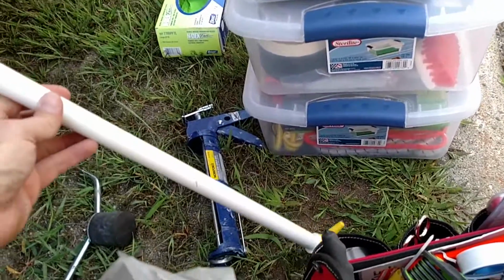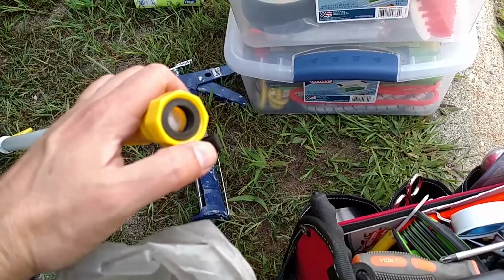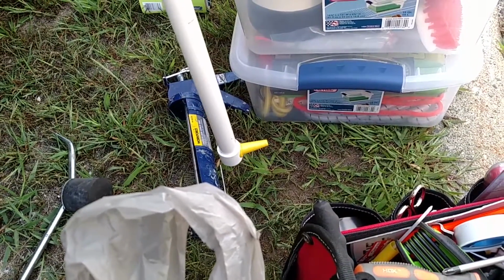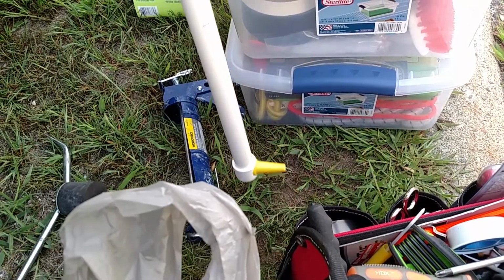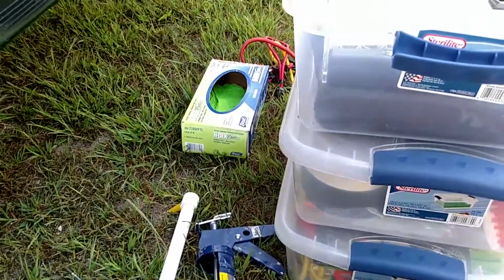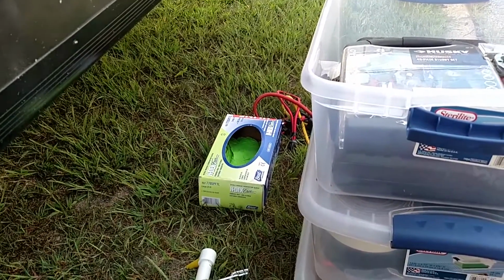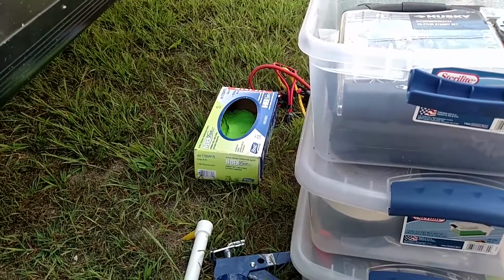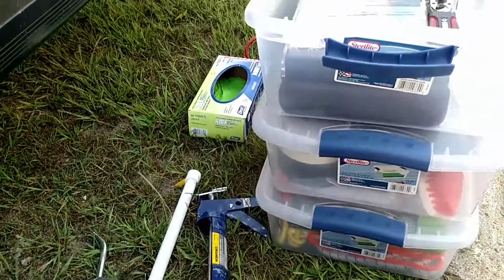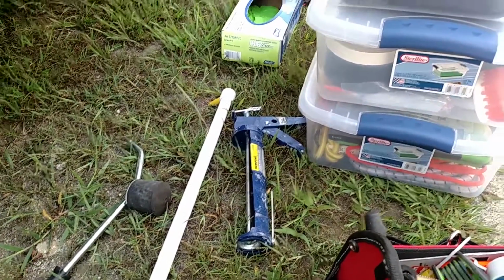black tank cleaner. So I mentioned that flexi hose earlier. You just hook it up here. You stick this in the toilet bowl into the tank, and then it sprays the water out, and you just kind of angle it around and rinse out your tank. We also keep rubber gloves up here for when we're draining the tanks, draining the sewage and stuff. One thing that's not here is actually in the garage, just like a gardening knee pad for when you're doing all this stuff on the ground. It just makes it a little bit more comfortable.